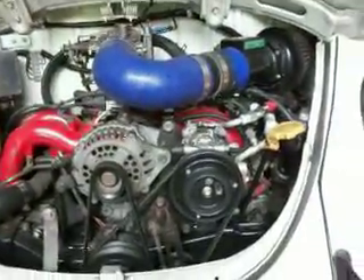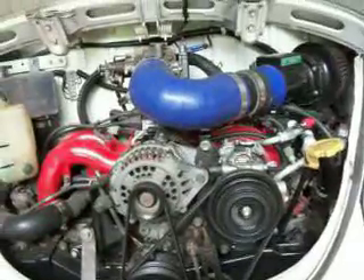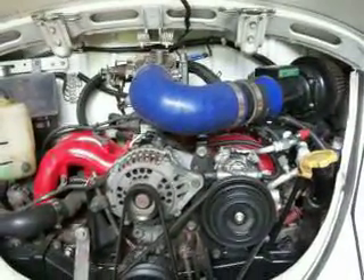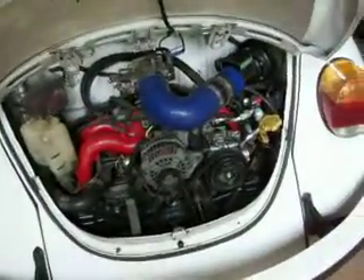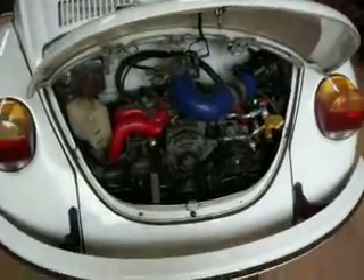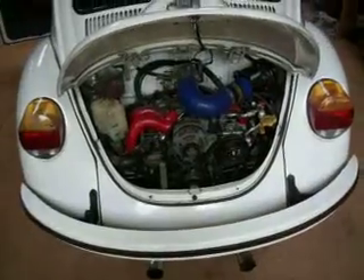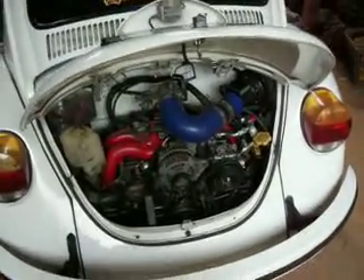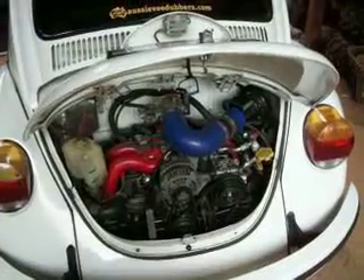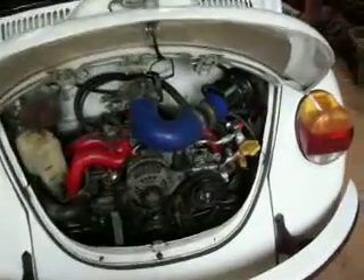The engine management controls the clutch for it. That's just so that when you start the car up, if you've left the air conditioning on, the compressor won't start up for about 5 seconds — just to give the engine a chance to start up and settle down. It also cuts it out if you go full throttle, and just makes it rev up when the air conditioning is running. As you'd expect, a 150 horsepower engine doesn't even notice the air conditioning running.